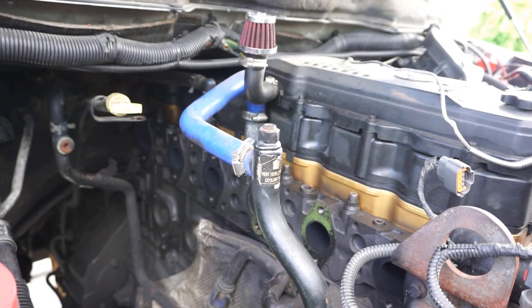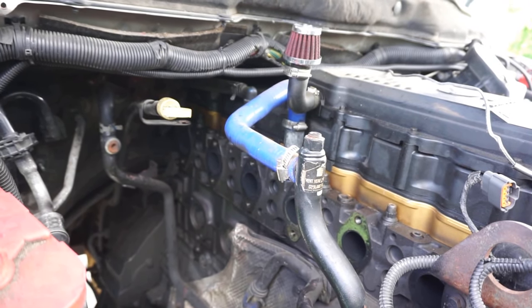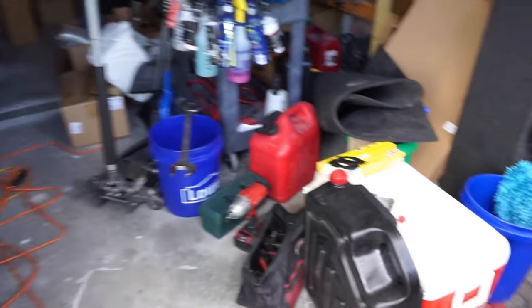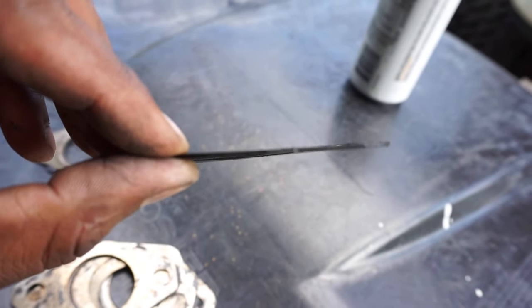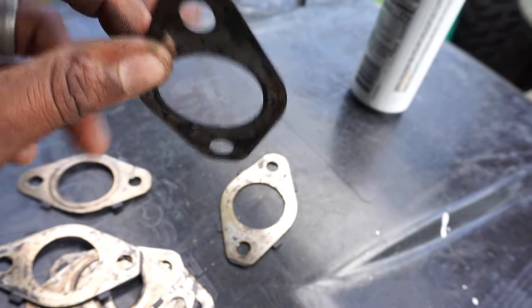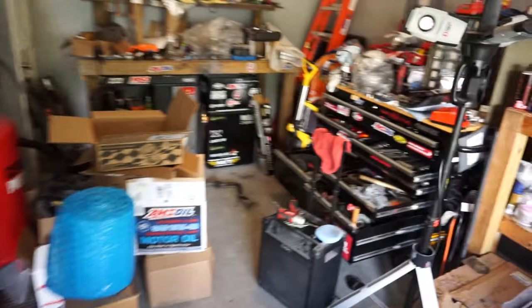I never had high EGTs and never figured I was losing exhaust pressure, which is actually a bad thing — because if your turbo is not operating in its efficient range because you're losing back pressure out the side of the manifold instead of going into the turbo, that's not good. One of the gaskets I took off was delaminated — these type of gaskets are multi-layered, maybe two to four laminates, and one of them had delaminated and fell off and split in different pieces when I removed it. Good news is we have brand new manifold gaskets.